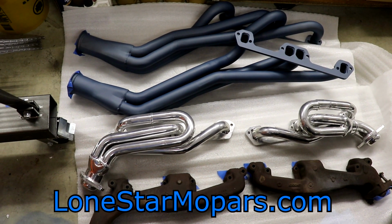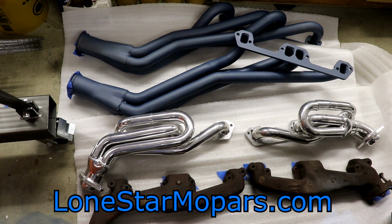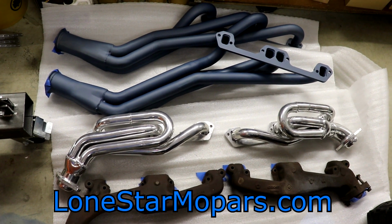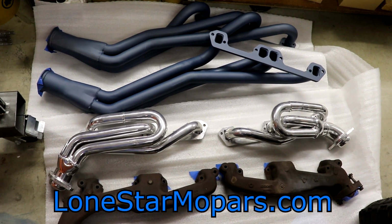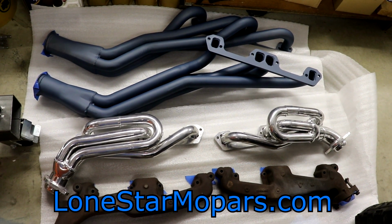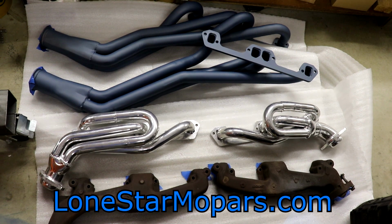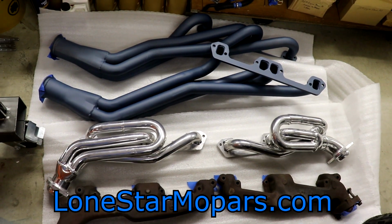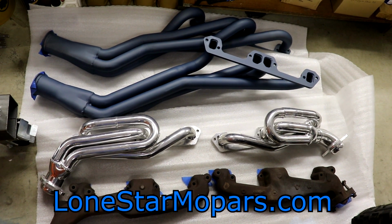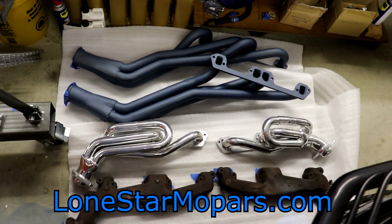The only issue is going to be if it maintains shape on the driver's side. If not, it's critical, and you would want to do the same thing with coated headers. When you go to pry like I did initially, I didn't care if I took the paint off or put a dent in them. Now I do not want to damage that coating. So what we'll have to do is wrap the ever-living snot out of it. This is why I keep used socks. You can slide them over, duct tape over the sock to keep it in place, put a pad essentially, kind of like a towel, handle, or pipe insulation, something around the pry bar, and then go to town and hopefully not nick or ding the coating. So anyway, there they are. I'm going to can it and get these things on the truck.